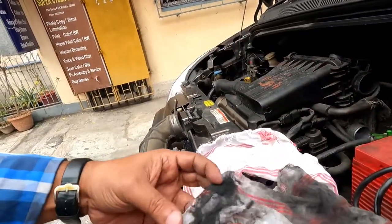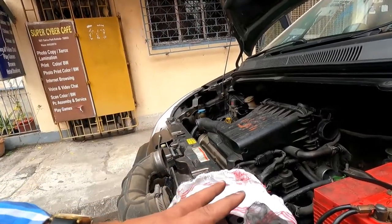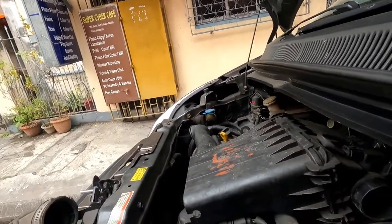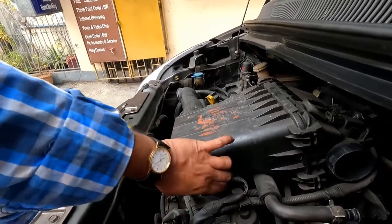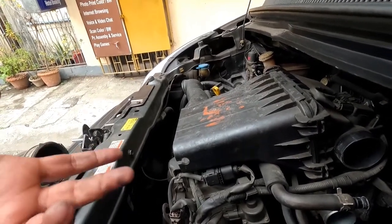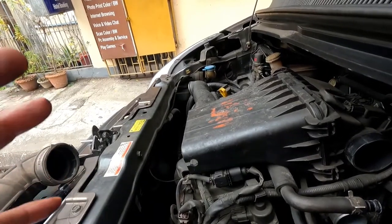This actually helps in cold conditions — you can easily clean like this. After cleaning, since the throttle body is now flooded with the throttle body cleaner, I should rest the car for half an hour and then I will start the car and see the difference. If required I will clean it further. So let's give the car a rest of half an hour.